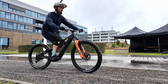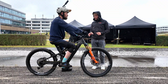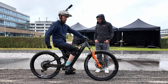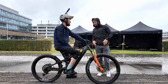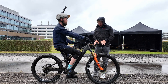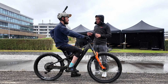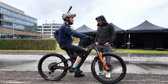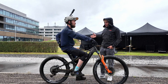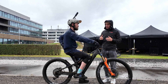When trying this with the ABS off mode, it's really hard to out-brake the ABS in this situation because it's so much at the limit of braking — but still stable. The rear wheel lifted but wasn't high enough for the system to release the brake. This is intentional: because this product is designed for high-potential mountain bikes with a certain skill level, Bosch says the rider is capable of managing small stoppies — that's normal in mountain biking. In touring mode by contrast, the rear wheel doesn't come up at all — it's just smooth braking, though braking distance gets longer but the bike is more stable.